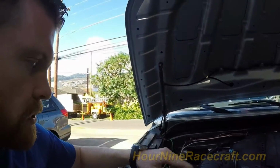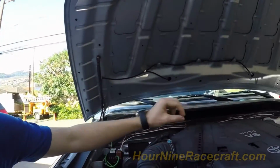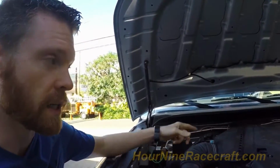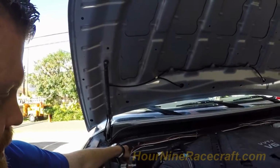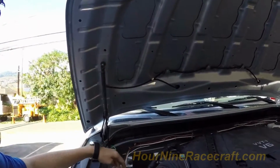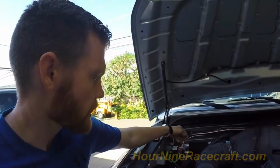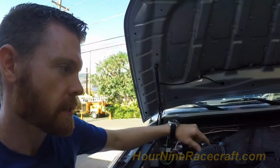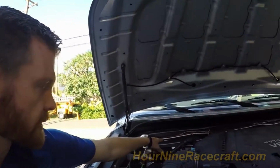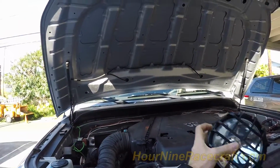Basically, there's a positive wire that comes off the relay, and then there's a very small, 24 gauge signal wire that comes from switches that I have in the interior, and that's running through this. For all the triggers for all the relays, I'm running Cat 5 wire. It's an Ethernet cable that plugs into your computer, and there are 8 24 gauge wires inside this little white cable. I'm about to play a little unboxing clip from when I opened up these.